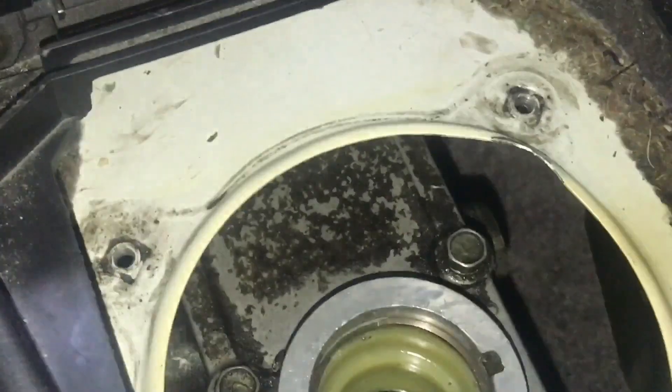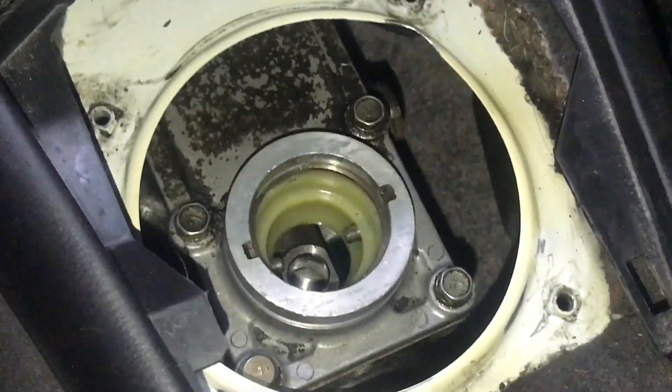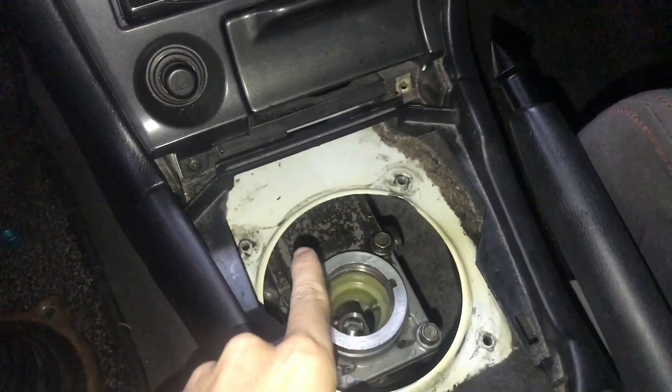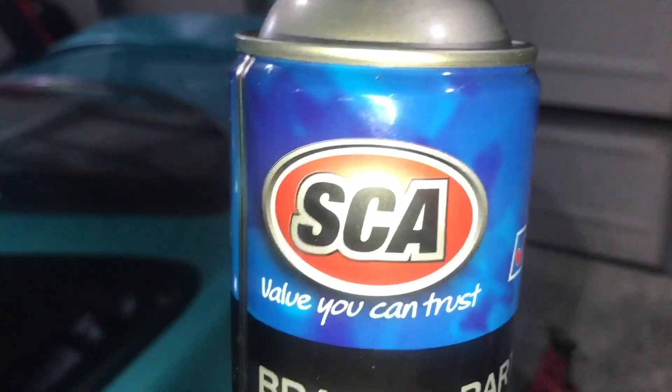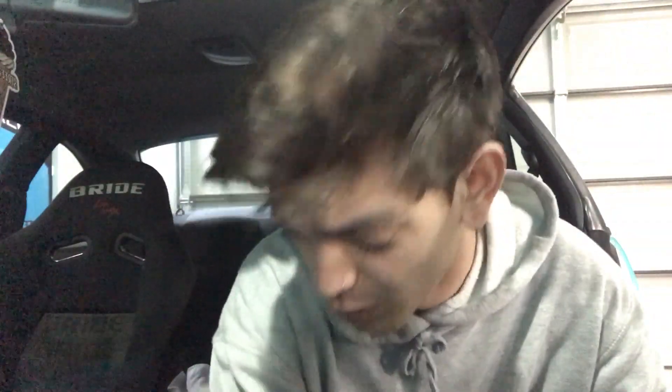You can see all the stuff that's made its way out of this thing. Let's go clean that. Grab your super cheap brake and parts cleaner — no residue, this is the stuff. Grab your rag too. Brake parts cleaner and our rag here. Make sure to put something in that hole while you are degreasing or cleaning the outside — you don't want any brake cleaner or parts cleaner in the actual gearbox itself. I'm sure that wouldn't be too good for it.